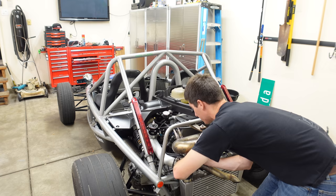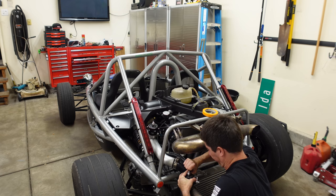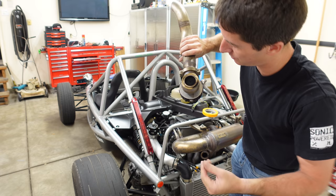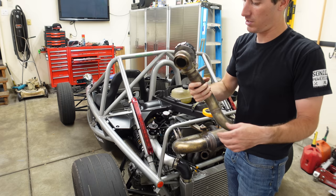This wastegate's on a 10-pound spring setup now — a 4 and a 6. So this is our wastegate and the dump tube, and it looks like we actually had a little bit of bypass there. I don't know if that's from our breakage or just a little bit of a leak in that baby V-band. Those baby V-bands are very annoying to work with, but they're so pretty. I'll clean that up when it goes back together — hopefully we can keep it from leaking on version two.